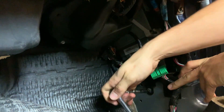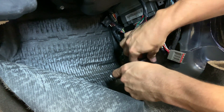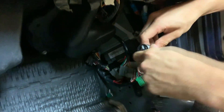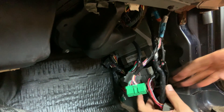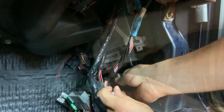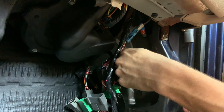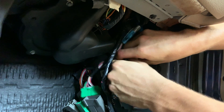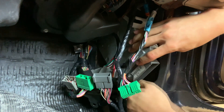To remove the black bracket that is holding the connector bodies in place, remove the two seven millimeter bolts that are holding it to the chassis — one here and the other up here. Once you've removed those, set them aside safely and you can push the bracket and connectors out of the way to expose the ECU. Loosen the 10 millimeter bolt that secures the ECU connector to the ECU; as you loosen this, you'll notice the connector backs out of the ECU itself. Now you can remove the five and a half millimeter bolt from the white plastic bracket just to the right of the ECU connector. Be really careful not to drop that into the kick panel — ask me how I know. Now you're ready to remove the factory harness from the ECU, and then you can remove the ECU from the vehicle.